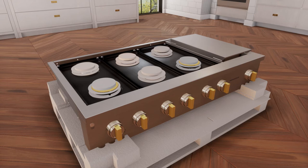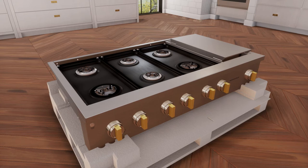Cut the ties holding the grill grate to the grill frame. After removing the ties, lift off the burner caps and remove the underneath foam pad, then lift off the burner heads and remove the underneath foam pad. Repeat for other burners.